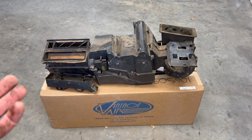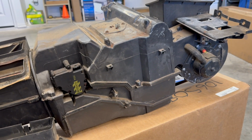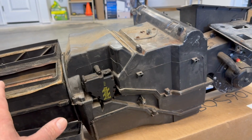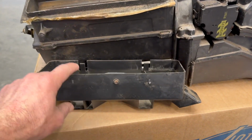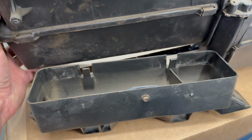That was easy enough. To say the instructions are not complete would probably be an understatement. It mentions removing 3 connections from the stock evaporator unit, but I want to show those to you. Also, this little distribution manifold attaches to the bottom here. Take that screw out and snap it loose before you do anything.